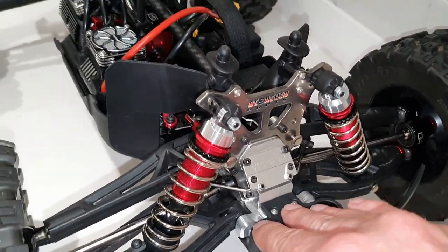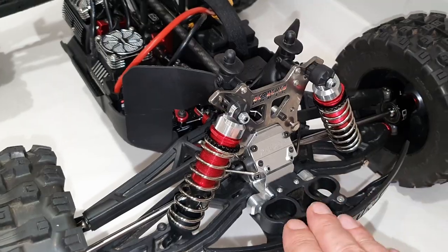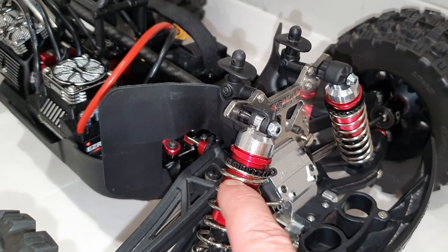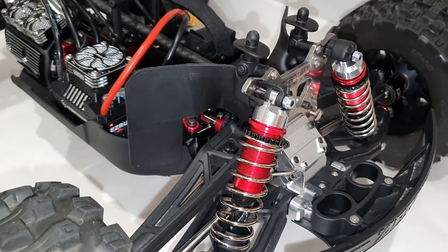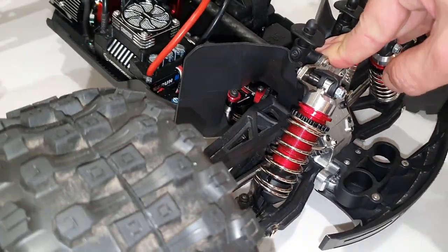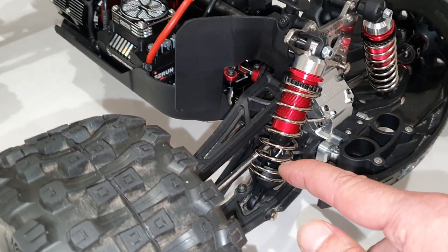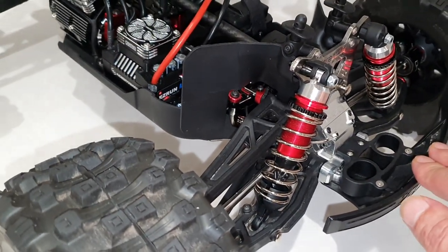At the moment this is the sort of action I've got — I'll push it all the way down and it's slow enough to come back up. I've also got M2C Racing shock tops on here. Inside is a little disc where the shock piston is, but on that disc it's got more holes one way than the other — when you're pushing down it runs through about eight holes, but on the way back up a different set of holes channels fluid against a little rubber O-ring on the inside which causes friction. They call it zero rebound — there's no such thing as zero rebound, but it does reduce that rebound a huge amount.